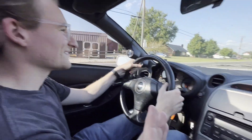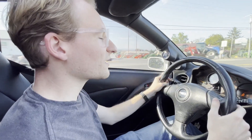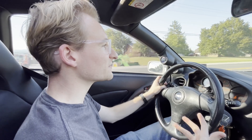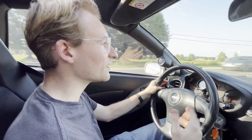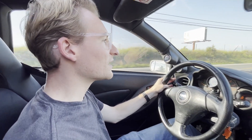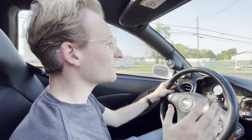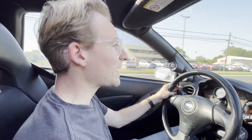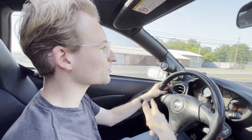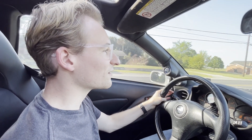I still felt like I heard a little bit of that burp sound. Yeah, there's still some of it, it just kind of quieted it down. I can feel a difference in the response of the car whenever I wasn't on the supercharger. That paired with that noise — when I'm letting off the throttle you get that throttle plate closing up and that build-up of pressure. That quieted that bark down a lot, which told me that air is making its way out through the bypass valve and recirculating through the supercharger. I kind of like the balance — you get a little bit of a recirc sound, but you also still have some of that Blitz signature sound that everyone is used to hearing.